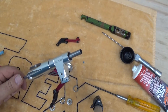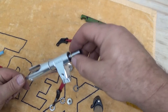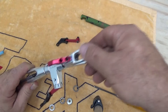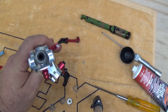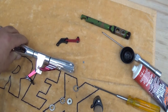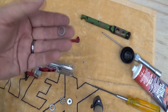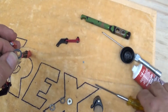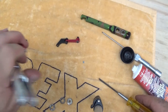First thing that goes on once we're ready to put the grip arm on, there's a brass spacer. This goes between the grip and the main rotor block. The next part that slides on is the grip itself. Now that's together, and if you can look in here, the main spindle shaft is coming through that grip arm right there. The next things that go together — there is an inner spacer. This goes between the inner race and the first thrust bearing. There are a couple different ways to do this; this is just one way to show you. We've got a spacer in there.